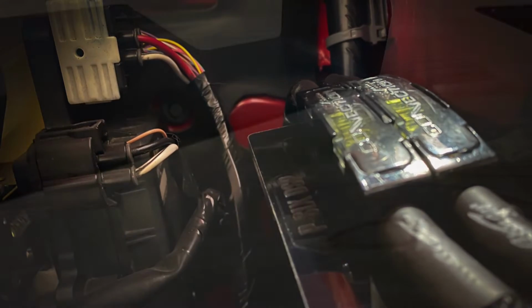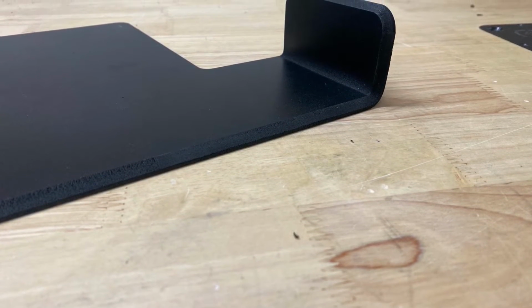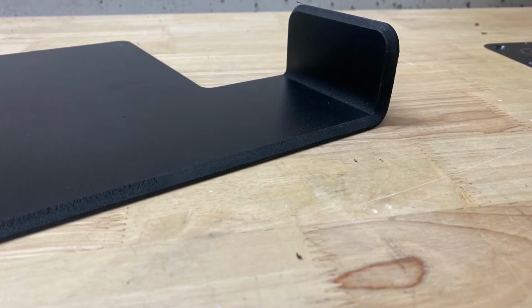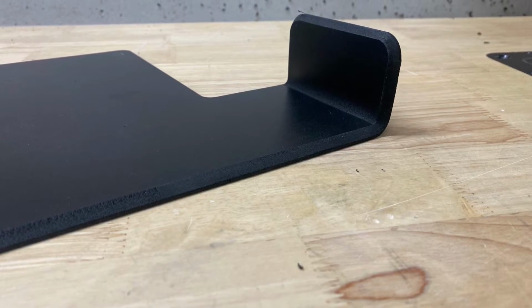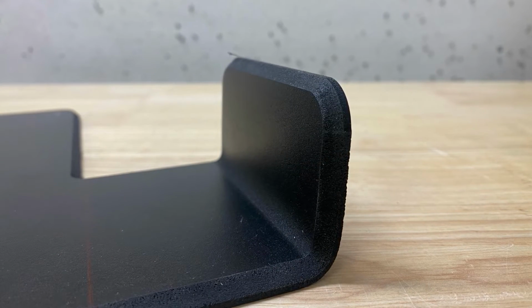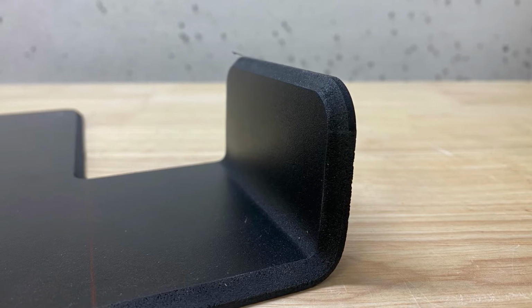No permanent modifications were done. Space was going to be a huge concern, so I started drawing up designs on the computer. Once I found a design that I liked, I cut everything out on the router, gave it a profile, and then heated everything up. These adapters are made to fit underneath the driver and passenger seat and allow accommodations for both amplifiers in a factory fit.